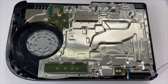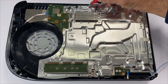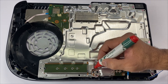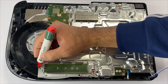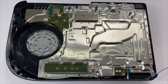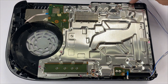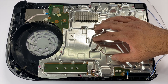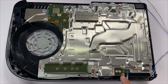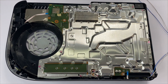Next we have 11 screw holes where there shouldn't be any screws, so I'm just going to mark those down. There shouldn't be any screws in these screw holes. Next we need to remove the heat sink metal protective plate — there are 41 screws on the silver heat sink protective plate, and then there are two motherboard screws, one here and one here. Let's remove the 41 heat sink plate screws first.